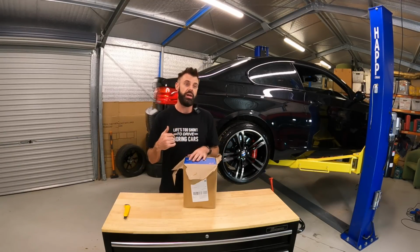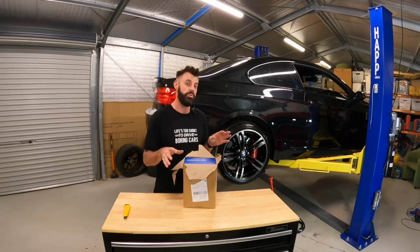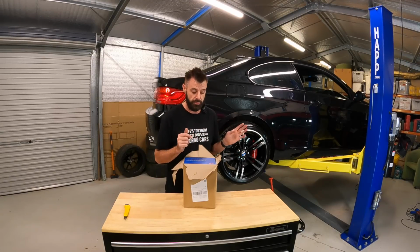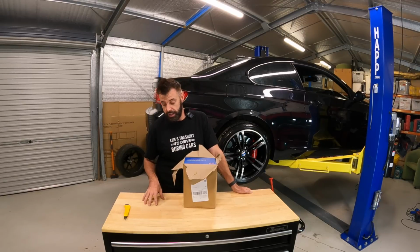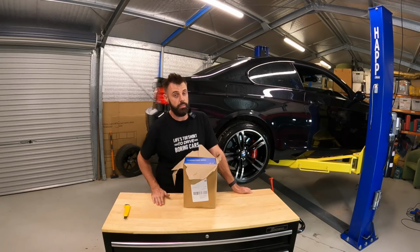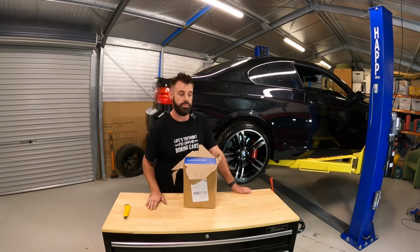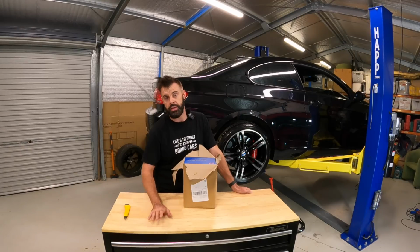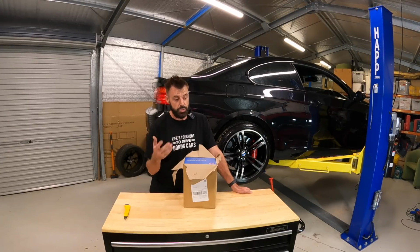So when we pulled that motor out and went through the whole process, I had a heap of people contact me about the dangers of running high boost with twin turbos on these N54s. I was a bit taken aback by it at first, but ended up getting even information from Mr. RB Turbo himself through somebody else, but we've got to assume that it's correct. Long story short, there are issues with running upwards of 27, 28 psi on the stock housing turbos, which is what the 17Ts and the 19Ts are. And it sort of makes sense.